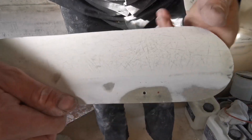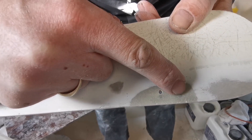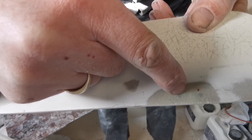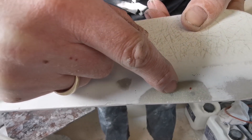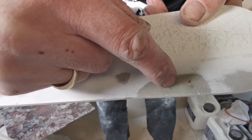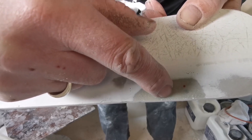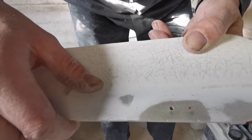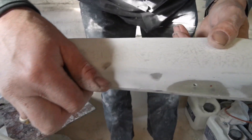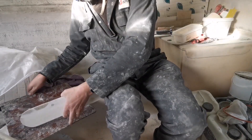There's my new hole and you can see just underneath it where the old holes were. What I didn't want to do — I thought if I drill there it's going to break out into the old hole. That's only got to be filled, which means it's soft, which means the screw could eventually walk down into there and I'd have a massive elongated hole that's ripped out. So at least I've got a little bit of glass in there to hopefully stop that from ever happening. That's my theory anyway.